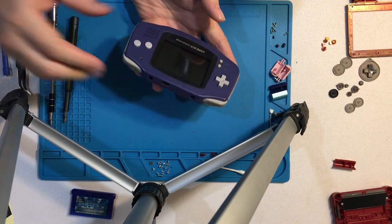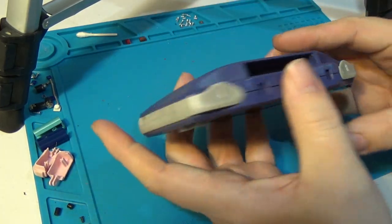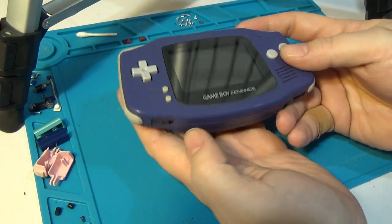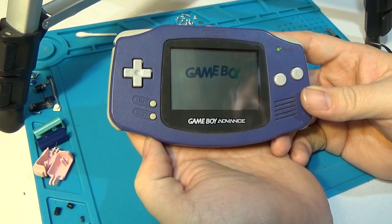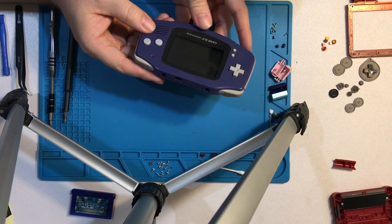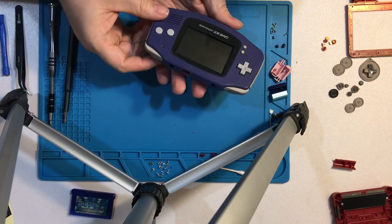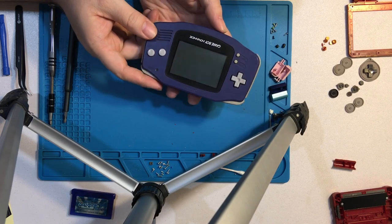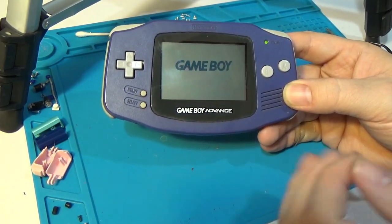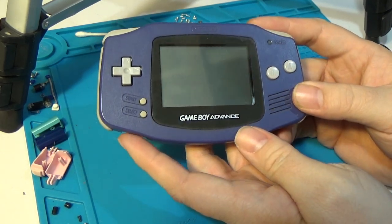This shell overall is not too bad of condition. There are quite a few surface scratches on the screen, some discoloration on some of the buttons on the sides, and some stickers on the back. The big thing with these is the power button is awfully flaky — sometimes it'll work, sometimes it won't. The contacts on the power button just get old and dirty and slightly corroded, causing it to not make a solid connection. So while we're doing the swap of the case, we'll go ahead and clean that power switch connection as well.